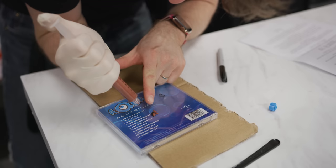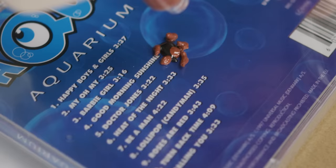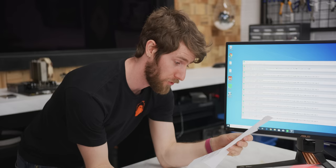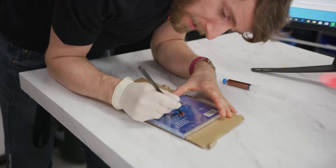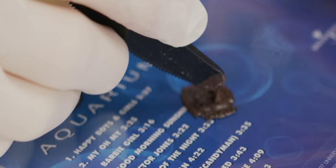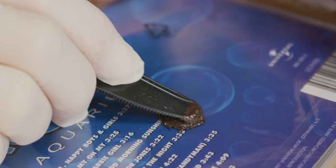They even warned me and I knew this was going to happen — I used too much of the black syringe. After checking, it looked about twice the size of the orange portion, so we did three more orange ones to correct the ratio. The instructions said to stir the components thoroughly until the color is a completely homogenous dark brown, then mix for another 30 seconds. I used a plastic knife. It's kind of grainy, which makes sense given it's made of little grains of diamond, graphite, and dendritic copper. I followed instructions carefully this time because this stuff seems like serious science.